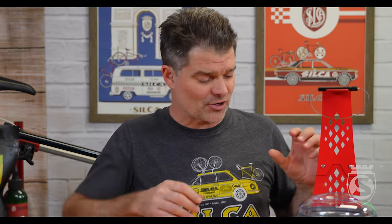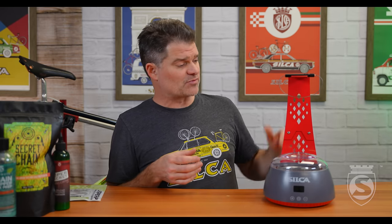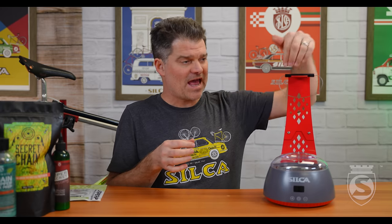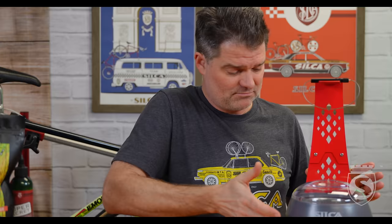Really super fast heating — 10 to 12 minutes. We've got a custom full-circumference heater band that heats the wax really evenly. PID control, not thermostatic, so it ramps nicely with no risk of burning or damaging the wax. There's a beautiful wax stand with a cable coupler — you feed the cable through, drop the chain in, then hang it back up at the top to cool and harden. Your system is right there, not taking up all that much space, ready to use next time.